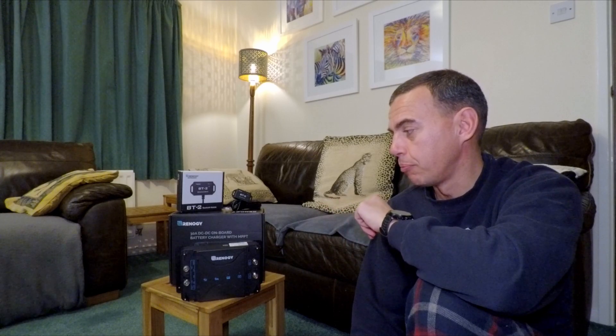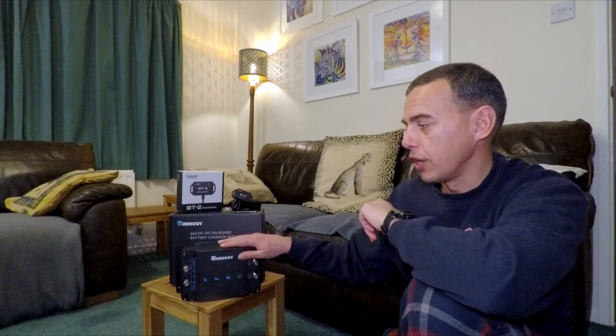The difference between the two is obviously the amps — but on the 30 amp version, if you're running the solar panel and your alternator at the same time, you only get 15 amps from the alternator, whereas with the 50 amp version you get 25 amps. To pull the full 30 or 50 amps you'd have to disconnect your solar panel if it's a permanently fitted system. For me that's not a problem because my solar panel is a folding one. These units also prioritize solar, and if the sun is shining brightly it'll also trickle charge your starter battery — a great feature if you're stationary for long periods in a sunny place like Morocco.